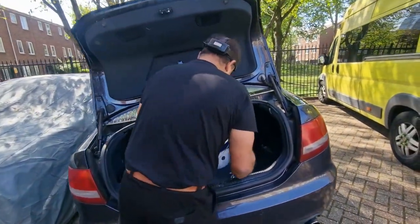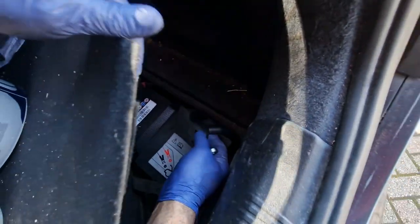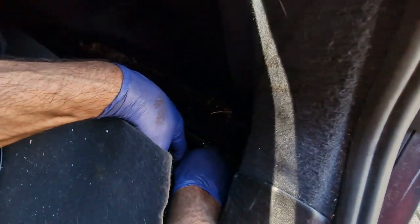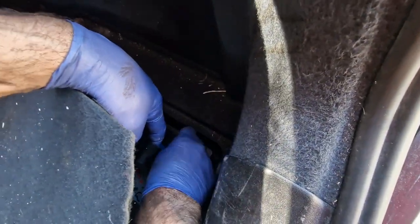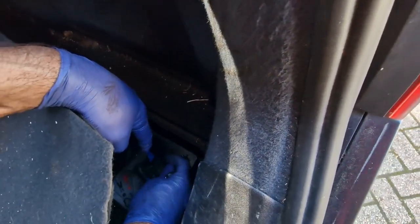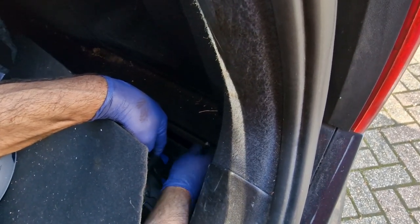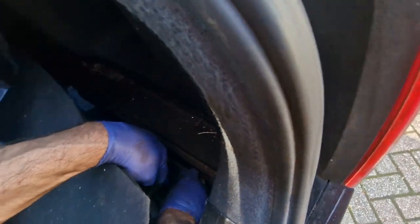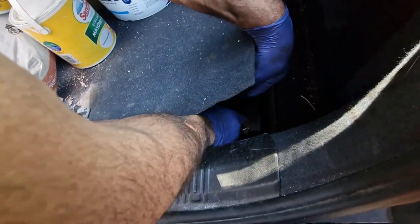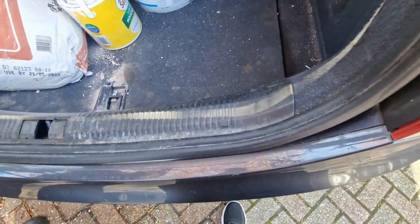Undo the battery terminal. You can see it's got all these paints and stuff in there. There's the battery. I'll open that up a little bit and just take off the negative terminal. I'll do this before any electrical work, because we're going to remove the cables off the starter motor and they're live. So if I just disconnect the battery, now we're safe to do that.